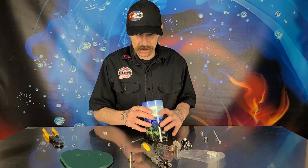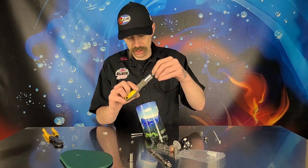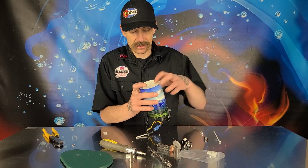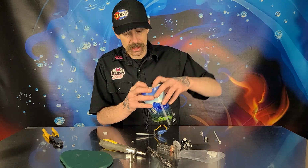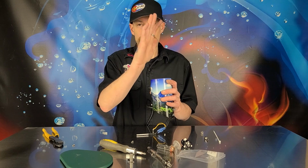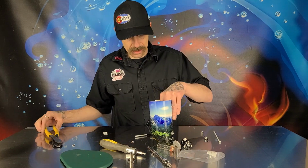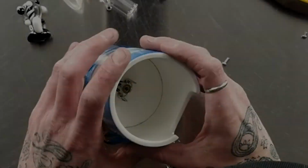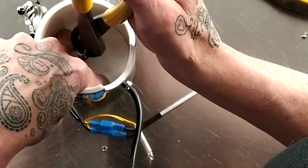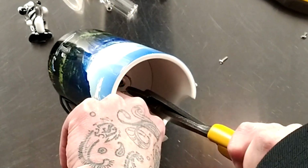That was a little pain in the butt, but again, the hardest thing is going to be with this fatter one up here. Right there, it just starts to push the tension clip out, and so we have it bent, and these can bend a little more out. If it's too far out, it needs to be pushed this way, so we make sure that they're in a little bit, if not slightly too much, and it's easy to go ahead and pull it back. So if you want to pull it back, what you're going to do is I press down on both of these, and I just grab this top right here. Needle nose will do fine, and I just kind of pry it back just a little bit. Be careful when you do that, and then open it up just a little bit.